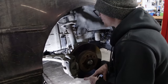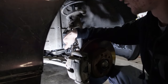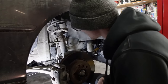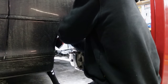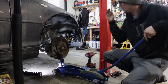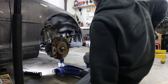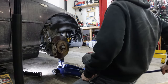The front seems pretty straightforward — we have one pinch bolt that's an 18mm down here, and then one for the sway bar end link which is a 16mm up here. We'll zap those two off, hope the Canadian weather has been nice to it, and the strut should slide out of the knuckle. The sway bar end link is sitting a little sideways, so I'm going to jack the wheel up a little bit to get it straight so it comes out nice and easy. We'll also use the jack to help with the install when we re-install too.